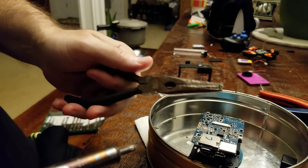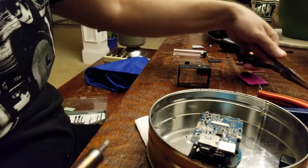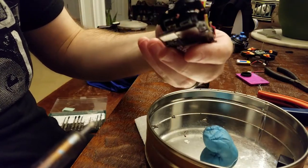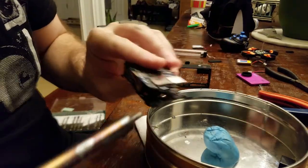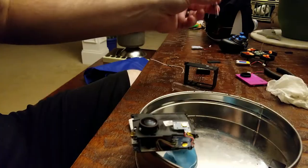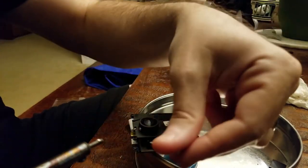Success! Got it out — the world's worst microphone ever. Now all we have to do is put the new wires in. Just so you know: positives on the inside, negatives on the outside. So we're just pre-tinning here — got some pre-tin on it.